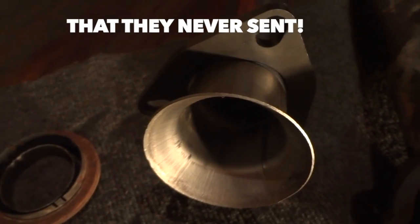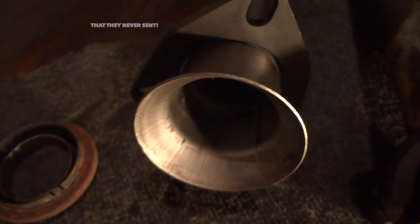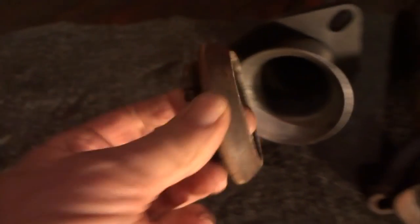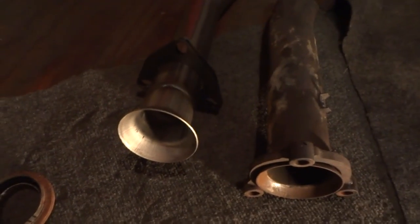The downside is you're pretty much going to have to take off your manifold and knock those other studs out. I mean, I could try it down here, but if I snap one, I still got to take off the manifold to get it out. So I might as well just take the manifold off to begin with. The gasket fits in here okay — it's not a problem. The problem is the design of this flange bracket. I could have just cut the pipe off and put a sleeve in here and somehow fixed this, but there's no point in cutting this perfectly good converter. My answer is just go ahead and take off the manifold and do it right, which I should have probably done first. But that's the way it goes when you're working on vehicles.